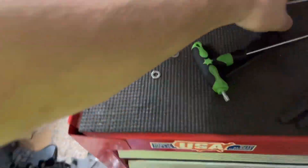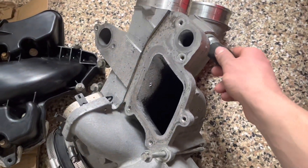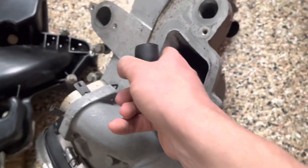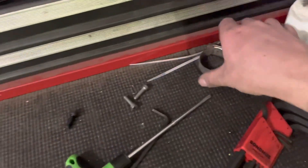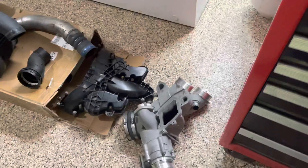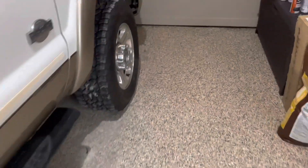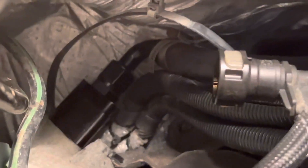I think these parts are about dry. I also have this rubber plug that is supposed to go right here because we don't have our EGR inlet anymore. There's black residue still in there but the gunk is gone — it's pretty clean compared to what it was. I'm going to squeeze this on there. The kit didn't come with anything, but I found a radiator clamp in my parts pile down at the farm, so I'm going to run it down tight as added security to make sure it doesn't fall off. I also did that for my CCV reroute hose — you can see that radiator clamp right there, just to make sure it doesn't pop off. It was pretty hard to force that on, so I bet it'll be all right, but that extra two seconds is worth it rather than having an issue down the road.